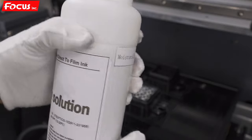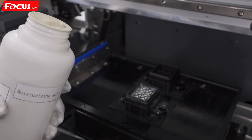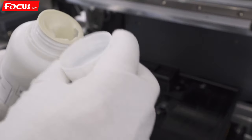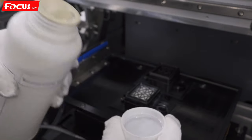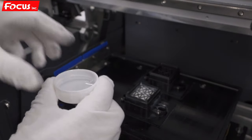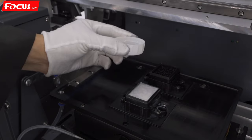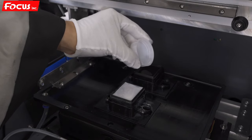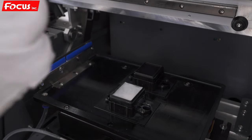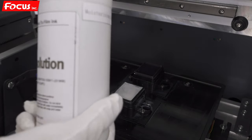Please remember, we can only use the clean solution that matches the ink in the cap station to keep it wet. We cannot use alcohol or any other liquid, otherwise the print head will get clogged. So use only the special clean solution that matches the ink. We fill it a little and put it on the surface of each cap station — not too much, just keep it full. Do this for each cap station.